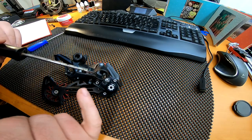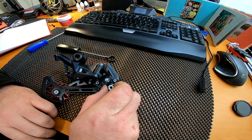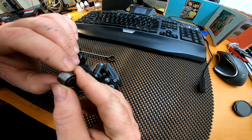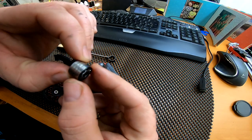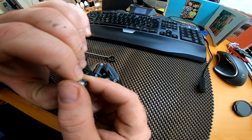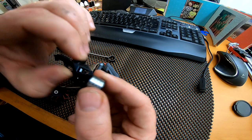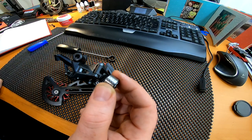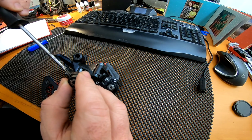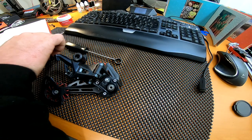You've also got this lever connected to the main lever — that's your pivot. As you pull that up, it turns the cam; as it turns the cam it puts more tension onto the spring, which in turn increases your spring tension for your clutch. What tends to happen is you get a bit of crud build-up inside there, or the grease just disappears because it's getting used so often when you're riding — it tends to burn the grease out.